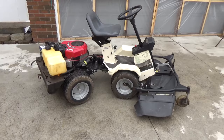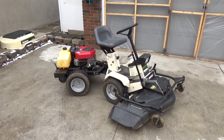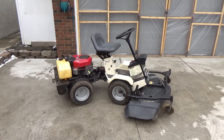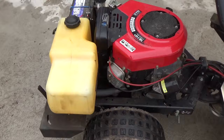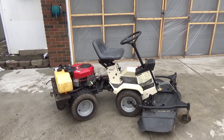I just wanted to do this quick video on this super cool machine that you hardly see any of here in Canada. ESF out of Quebec — you'll be able to get parts through them, and I'll leave a link in the description just in case anyone in Canada wants to contact them. For example, when this came in the choke lever wasn't working and we thought maybe the cable was seized. Turns out a 5/16th screw holding the cable conduit onto the bracket was a little too tight and wasn't letting the cable move — so now the choke works perfectly fine.